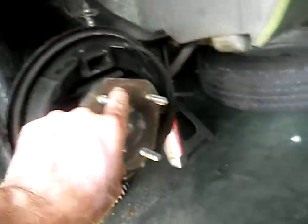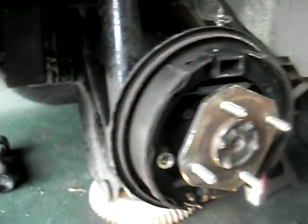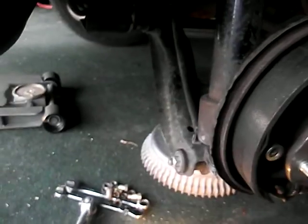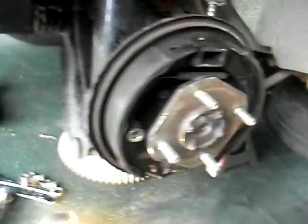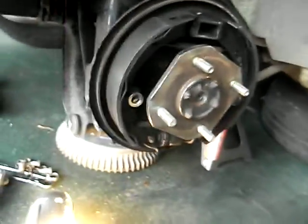Since the nut can't turn, I put the wheel back on with the wheel nuts, took the jack stand out, and lowered the car back down on its wheels so it's a roller again. As soon as you start to roll backwards, the breaker bar jams against the control arm and holds the nut. You can use the weight of the car — rock it forward and back — and it just spun right off. Not a whole lot of drama.